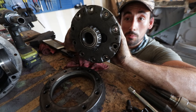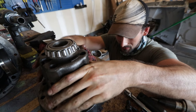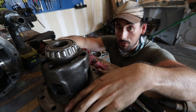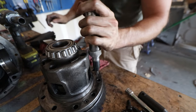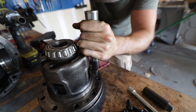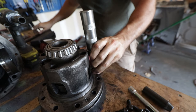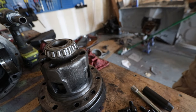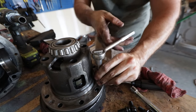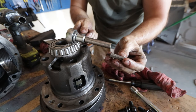I'm going to take it off of the bearing surface so we're not smacking on that, and I came up with a solution to prevent breaking it — just set it on top of the ring gear to keep it from sitting on the bearing. Let's see what happens — not fun. Plan B... there we go, that worked. Basically I just jerry-rigged a screwdriver into a socket.